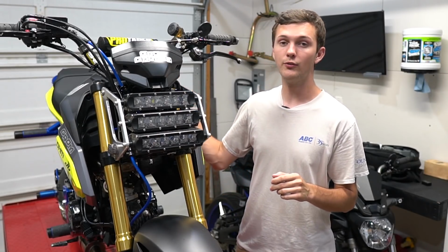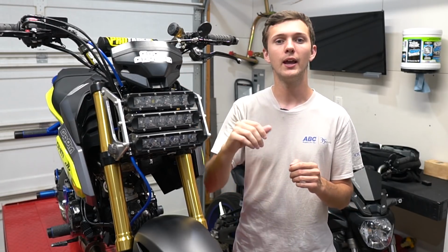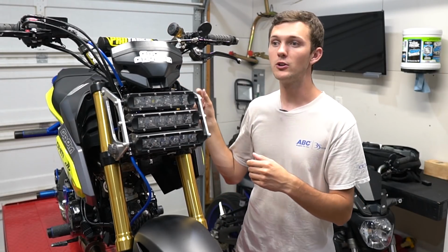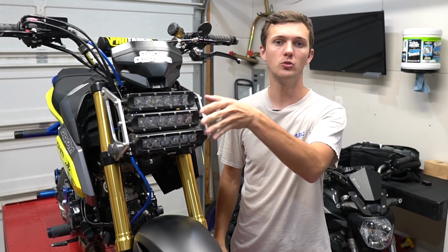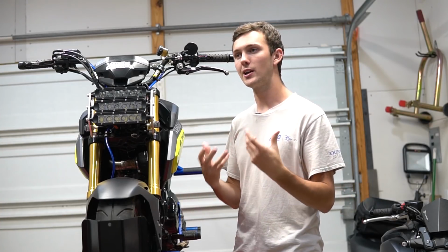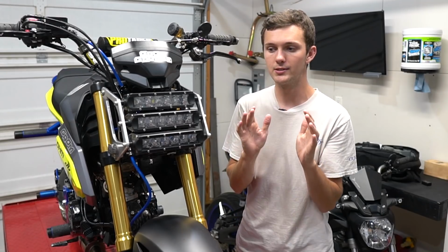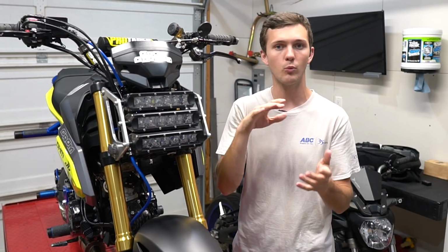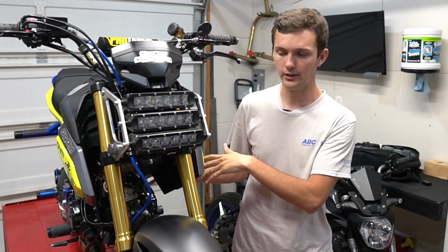But the 12 volt black wire from the tail light harness goes into the relay, and as soon as you turn it on, it connects the relay, and there's a wire coming straight off the battery straight to my bottom two lights. So it's plenty of power. It's an LED, so it's not going to pull that much power, but I just wanted to make sure it was going to be bright and good, because obviously it's going to be on during stops and goes, and I didn't want them flickering. So I just put them straight on a relay and straight to the battery.